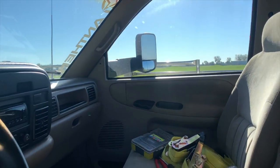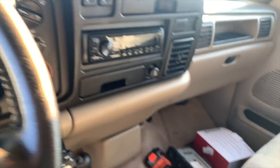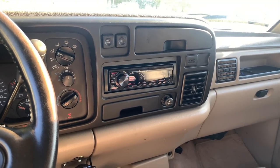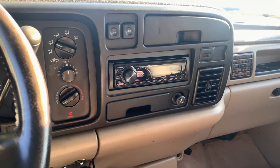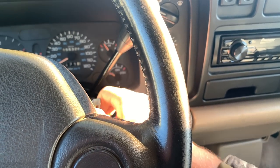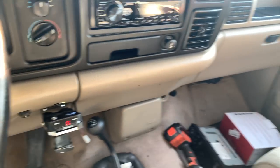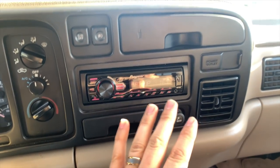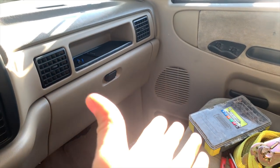The dome light just came on — that didn't work before. Put this blown fuse right here, now let's see if we can get the radio lights to come on. Everything behind the dash has already been wired. There it is — the IOD fuse fixed it! I cannot believe that, honestly. Let's start Nasty Red, let her idle and warm up a bit, and then I'll let you know how it sounds with the new speakers we installed and never really got to use.